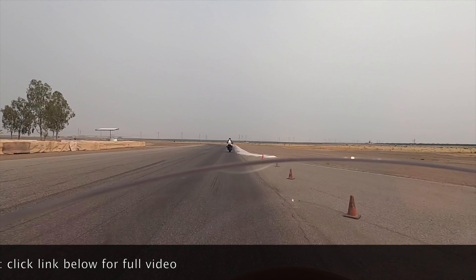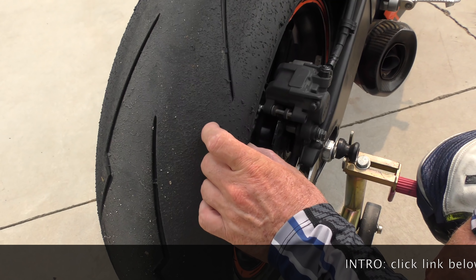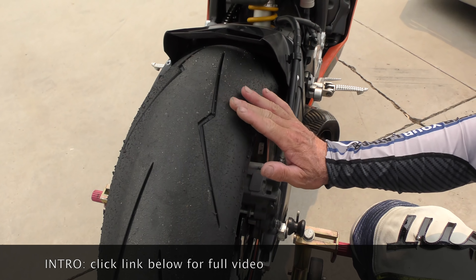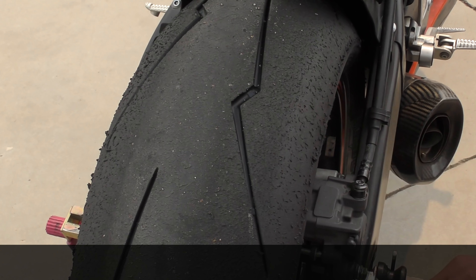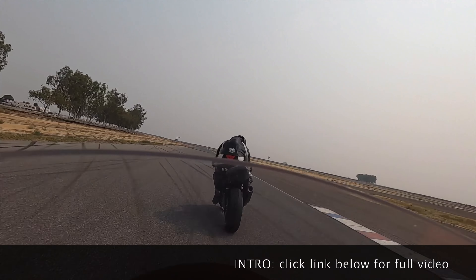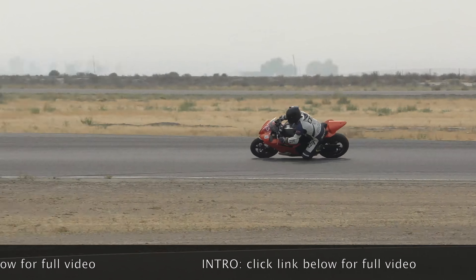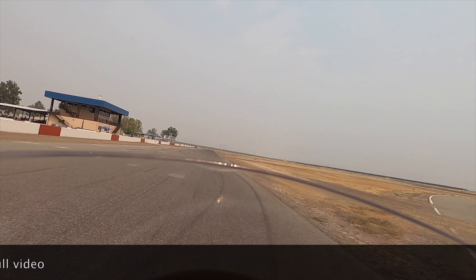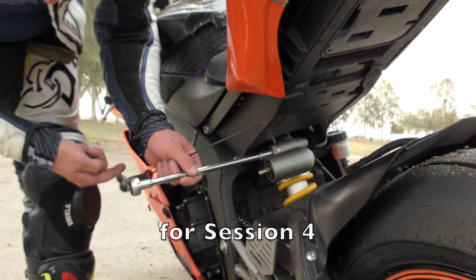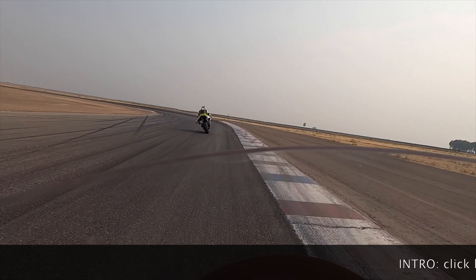The scrubbing lap is all about feeling your way around and what the tires are telling you. Nice and steady to feel what's going on in corners — how the front tire gives feedback and on the exit how much grip you get and how the contact patch changes under hard acceleration. Into turn one: good braking stability, not much movement in the front at all. On the fast side of the tire there's still a huge amount of debris, telling us the pressure is too high — the tire wants to go lower for a bigger contact patch. It's also really rough, which is accelerating the wear. Trail braking hard, I don't lose my line at all and exit the corner correctly.